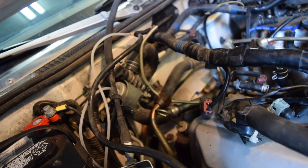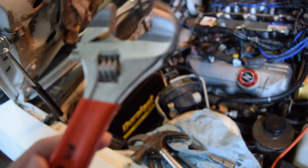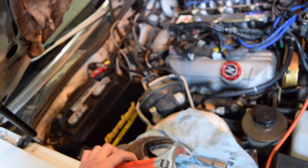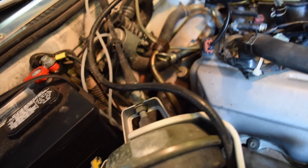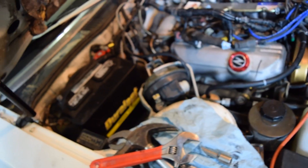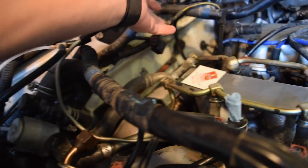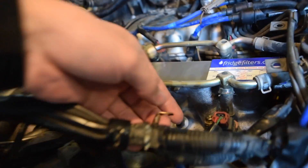What I had to do with that: I sprayed it with tons of WD-40, then I got this wrench stuck in on it — it's about an inch, almost 27 millimeters. I had the biggest 18 millimeter and it wouldn't fit, but this one is about 27 millimeters, so it was a big nut. I just sprayed it with a bunch of WD-40, got a hammer, and started just whacking it and trying to get it off — it finally came off. That's pretty much all you need to do. There are a couple vacuum lines up here to take off, and a ground on each side — one here and then one right under there.